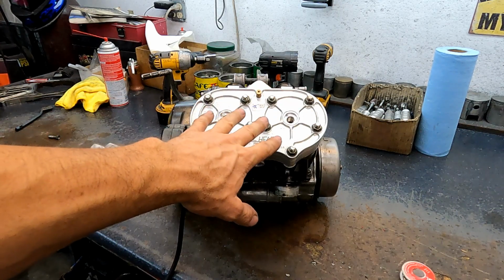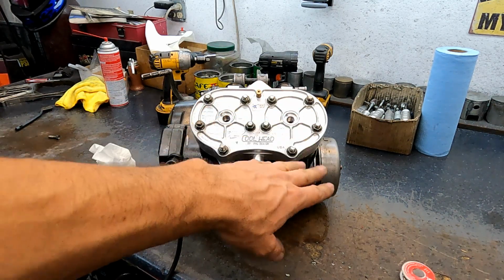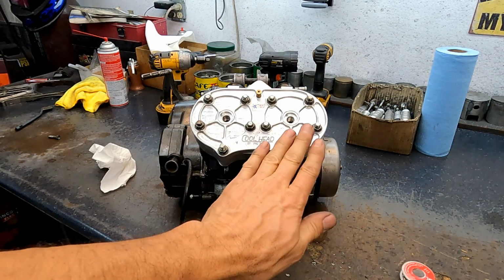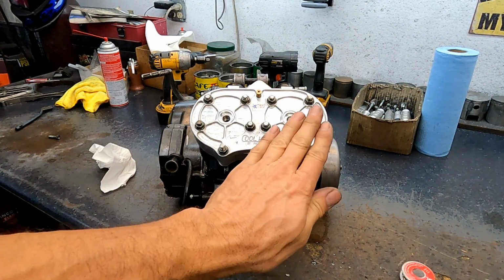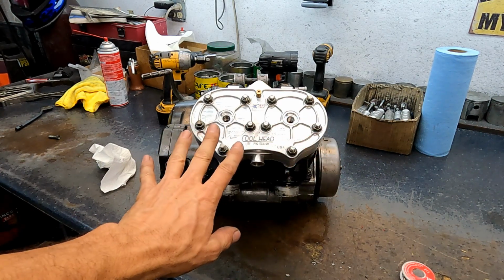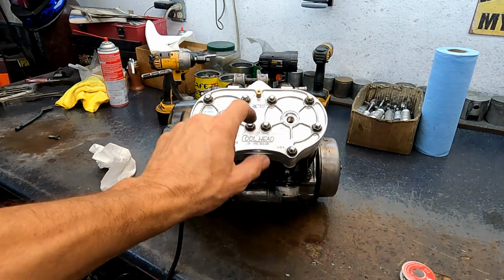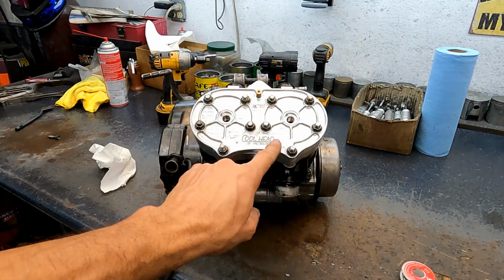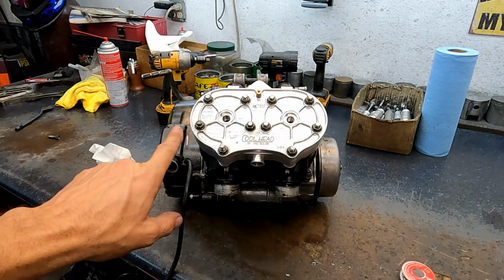If you want it tighter, you can custom order them, or you can play with your gasket setup. But if you're trying to get exact durations, that's going to make them differ just a little bit. But we're really splitting hairs here. Pump gas motor, this is fine. You want a bigger squish. Bigger squish is less heat. Less heat means more consistent horsepower.